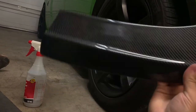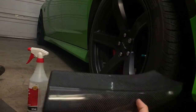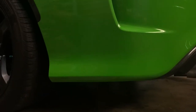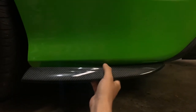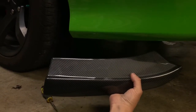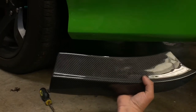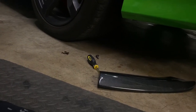I'm going to figure out where I want to drill into this. Relatively cheap stuff — nothing crazy expensive — but of course you are drilling into your OEM bumper, so you want to be careful. This is my first install of this, so I'm just going to set up the camera and try to figure out where I'm going to drill the holes. I'll pre-drill into the apron just to get the screw going, and then screw it into the bumper to see how it looks.